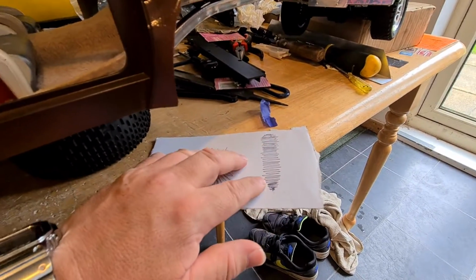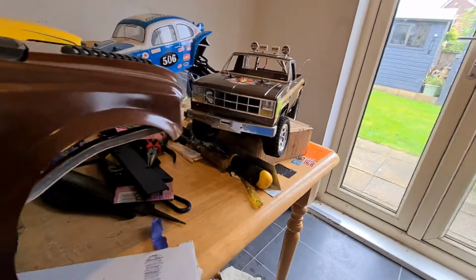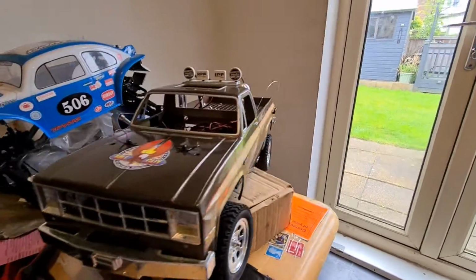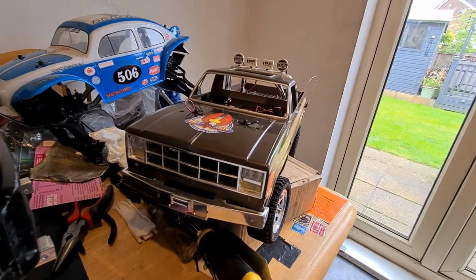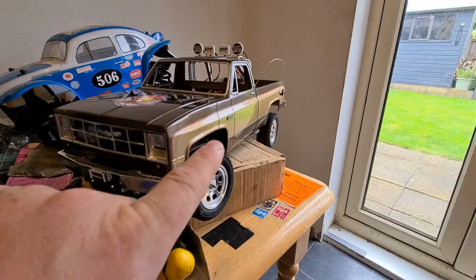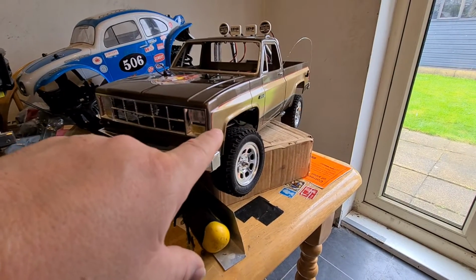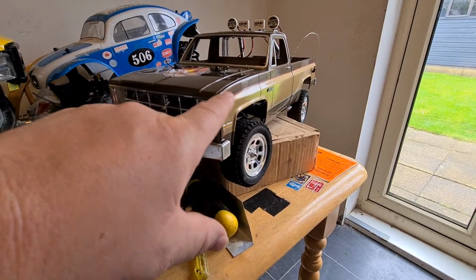this is a spray pattern that was given on the cans I used for that, and you just do the usual across and across, going up, zigzagging top to bottom and down, and that gives a fantastic even coat. And that was good coverage on that paint. It covered, there's only like 2 coats of colour on that truck. I sprayed it gold, and then I sprayed the brown over the top. So there's a grey primer, silver base coat, then the gold paint, and then masked off, and then the brown paint and the clear on the top.